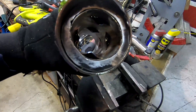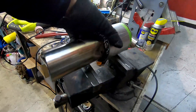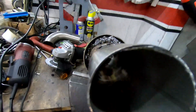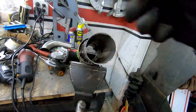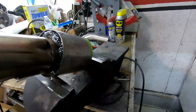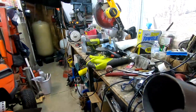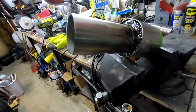They've got the end cap somewhat on there. I just tacked it on and put some steel wool around it. That might be the way to go. I just went like this and I'll put in a couple more wraps. Put another cap on this end to keep it from getting sucked back into the turbo — the turbo is only about that far away from it. I'll try that.